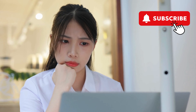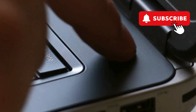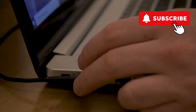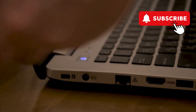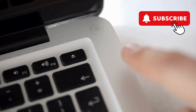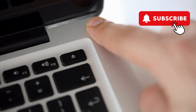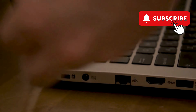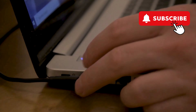If that doesn't work, you can try performing a hard reset. To do this, first press and hold the power button to turn off your laptop completely. Then, disconnect the charger and all other peripheral devices connected to your HP laptop. Now, press and hold the power button for at least 15 seconds. This will drain all the excessive power. After this, reconnect the charging cable to your laptop and press the power button to turn it back on.